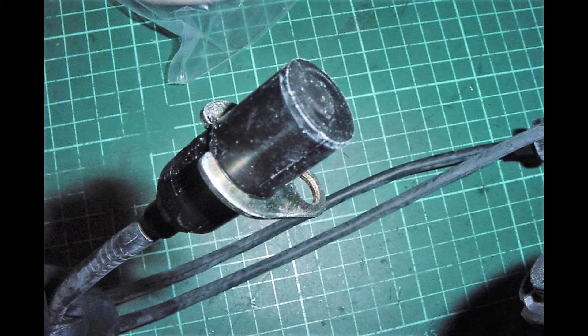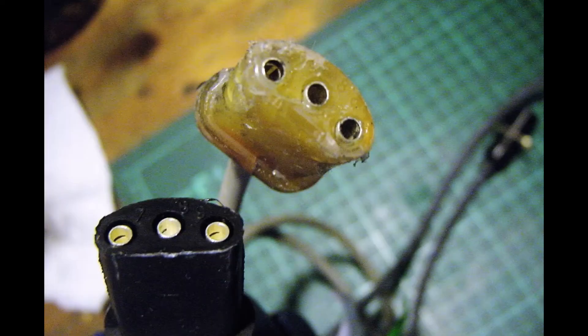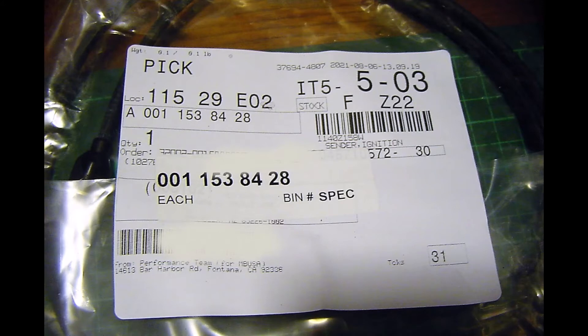The signal is picked up on this little sensor. This is a new one — no cuts on it, it's in good shape, it's actually brand new out of the bag. On the other end of the sensor you have a connector. This is the old connector. It was made out of a white kind of urethane plastic that has worn out over time — you can see it's crumbling apart and the pins are loose inside it. It needs replacement. Loose connections will give an intermittent signal on your tachometer. Here is a closer image of the replacement plug and sensor with the old cracked up one right next to it. You really want to replace this thing to make sure you get a good coherent signal coming into your tachometer amplifier. This is the part number — it's still available for Mercedes-Benz and you can get it at a variety of online vendors.